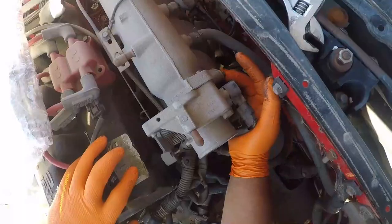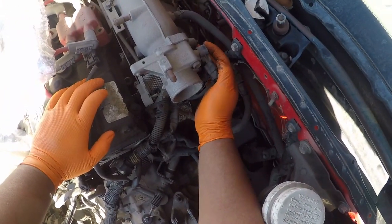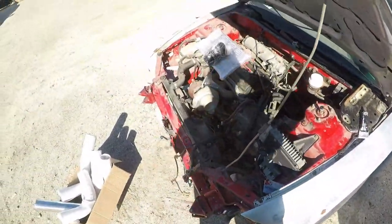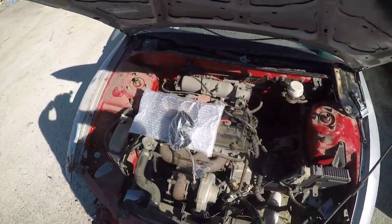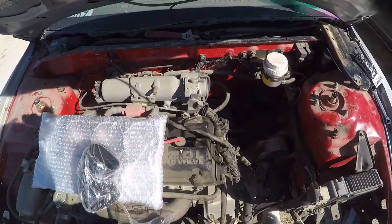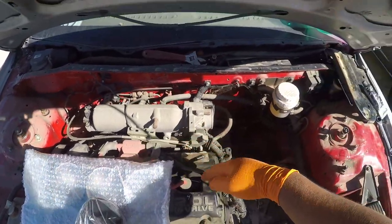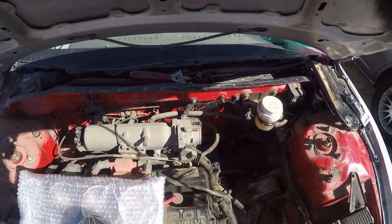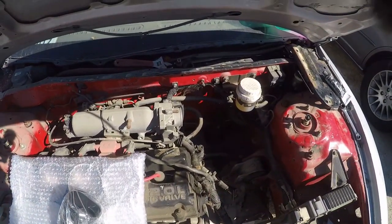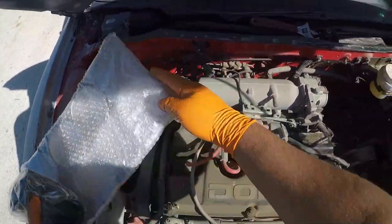I know it's here. There's a pipe that goes out. This part goes down this way. It goes into the intake. And pretty much what it does is it takes the exhaust fumes and recirculates them back into your intake. And the reason why it does that is obviously your intake is going to go back into your cylinders, and you're re-burning the exhaust fumes you already have burnt. But I guess if you have any type of residue, then it'll burn it again.